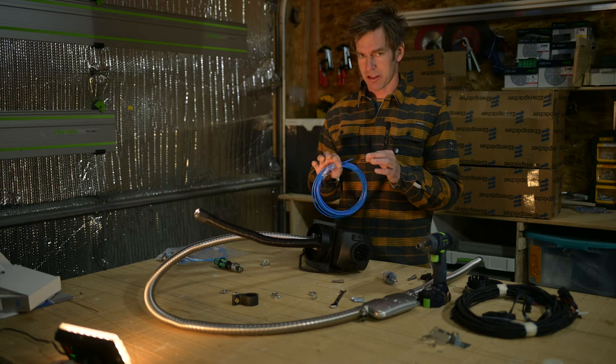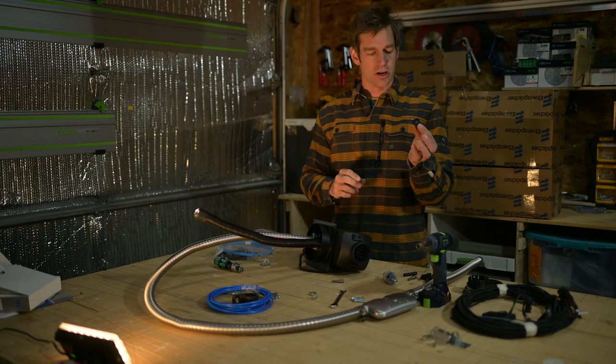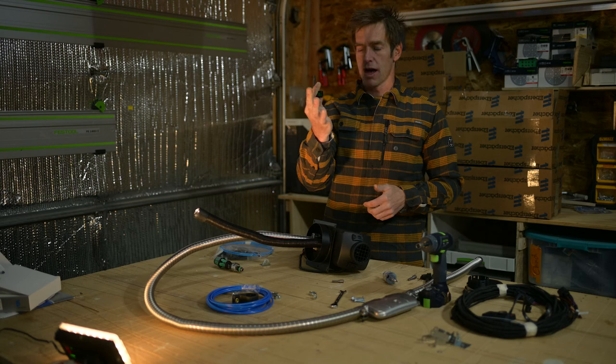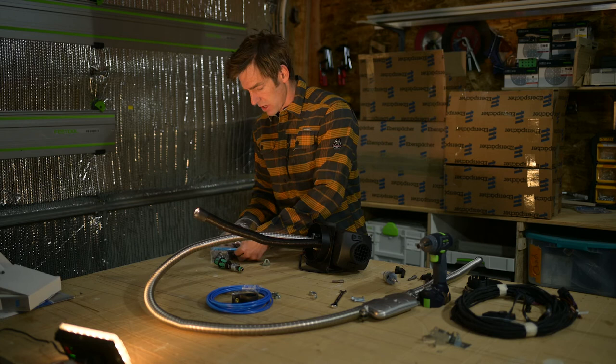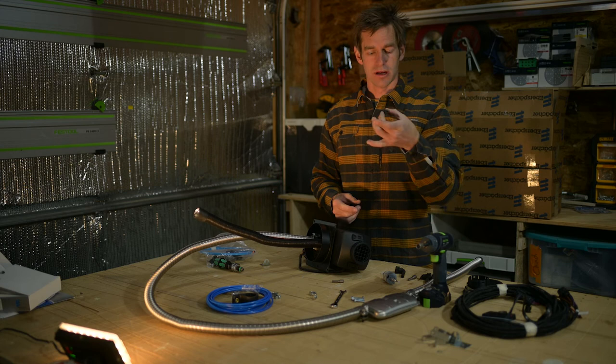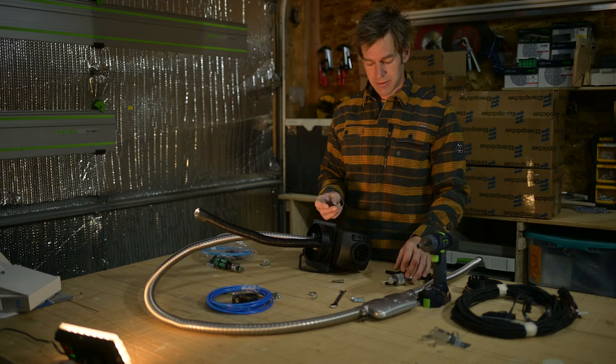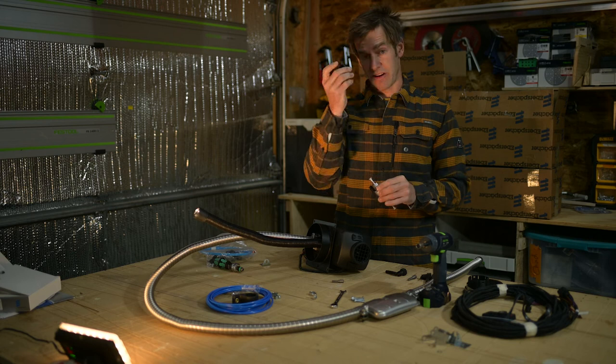Then it comes with a connector, and you'll see the other end of this under the van, and you just clip this on and you connect this, kind of makes it the same diameter tube. So this is really easy. So that's one way. The other way of doing it, in the kit they have a reduction sleeve, and this is a 6-4 mm. If you go to the fuel tap on the Sprinter tank, if you cut this off, you can connect this one on there. I think this is maybe a $7 part, so this is kind of easy. And then you just squeeze this on here, small side on here, and the fat side goes to your heater. This is kind of like the cleaner way of doing it.